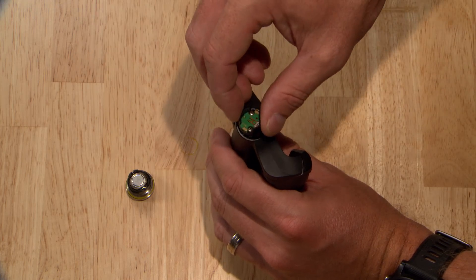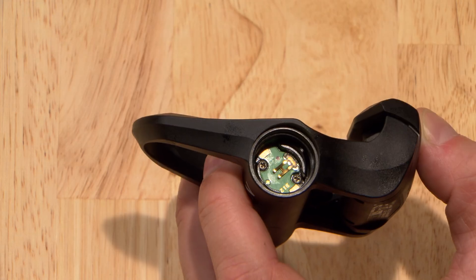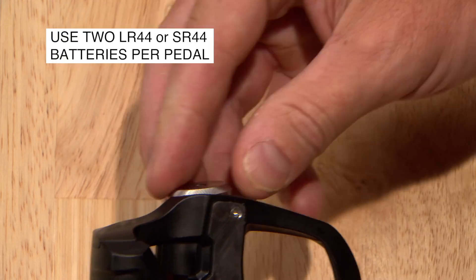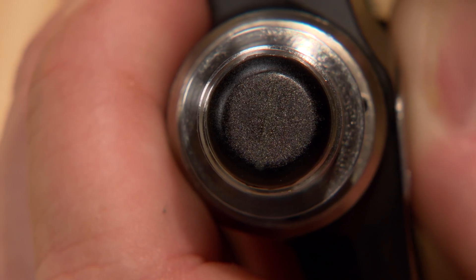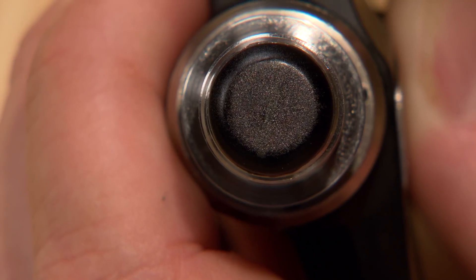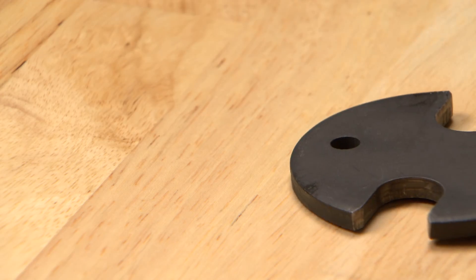Replace the battery board, rotate to align the holes, and reinstall the screws — the board should sit flush. Reinstall the batteries. The LED on the crank end of the spindle should illuminate to indicate the pedal has power. You're ready to reinstall the pedal onto your bike with a 15mm pedal wrench.